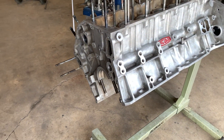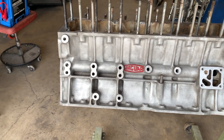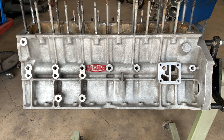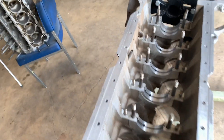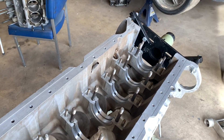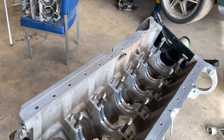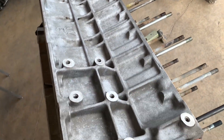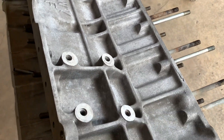What we've done here is used the oven cleaner all over the engine, and on this side we took a wire brush in an electric drill and buffed all that white residue off — that looks actually better than we needed it to look. The Jaguar logo there I just did for grins and giggles. You can see that on the bottom, this is just one application of the oven cleaner, and there's still some beige tint to the sides, but we can get that later with acetone and some Scotch-Brite. The other side still has that white chalky residue on it, which does tend to dissipate with time, but makes it look pale and anemic to begin with.